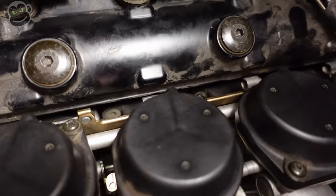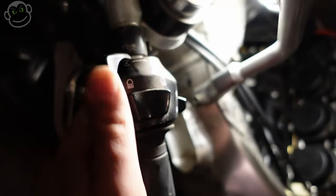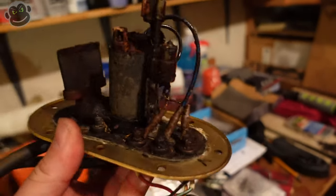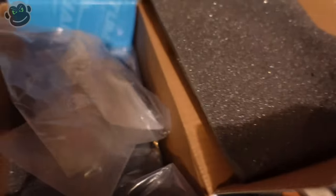We've got the choke cable hooked up nice and smooth - for those of you who are too young to remember, we used to have to choke our motorcycles. Next video we're going to rebuild this nasty fuel pump - we've got a new petcock, pump, screen, and filter. Once we rebuild the fuel pump, the video after that will be our first start attempt. After that we'll need to do brakes and some suspension work - refresh the suspension seals and oil, probably have the rear shock rebuilt. But once we get working brakes we'll be able to take it out for a little test ride around the block.